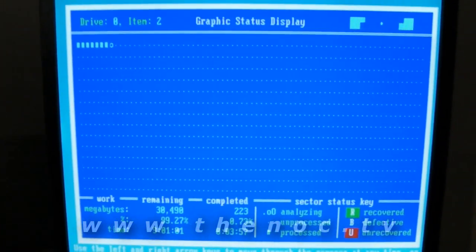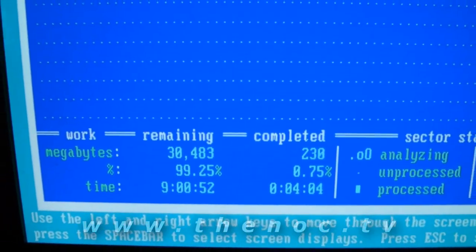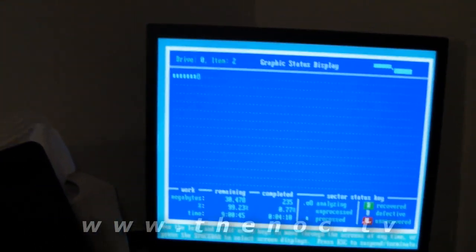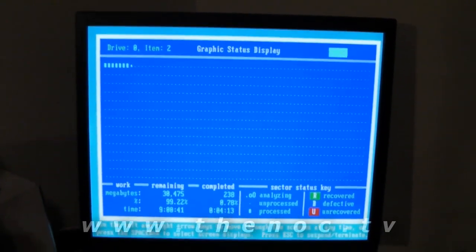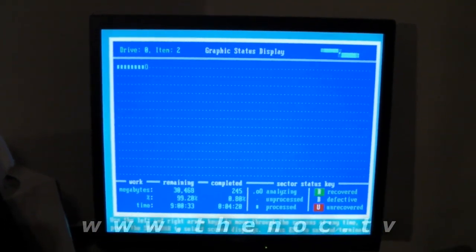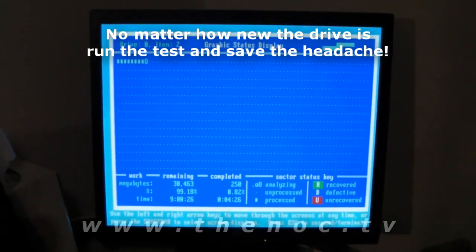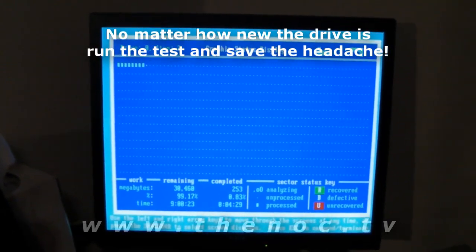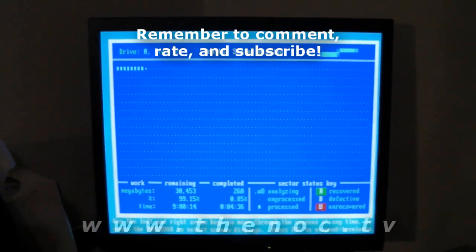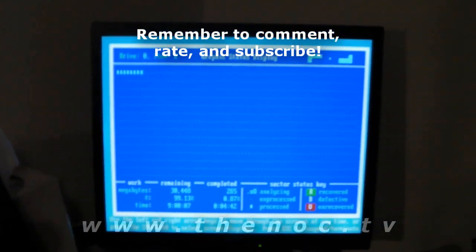So I'm going to let this go through and run entirely. As you can see down there, it's going to take approximately nine hours to do. I can work on other things in the meantime, such as editing and uploading videos to YouTube. But there you go — always run a hard drive test before you wipe and reload your system. Make sure it's working correctly. Don't always expect that the hard drive's master bad sector table is going to correctly report that it's got bad sectors. Sometimes Windows listens to it, sometimes it doesn't, and sometimes errors pop up before it even knows about them. So until next time, I'll see you later.